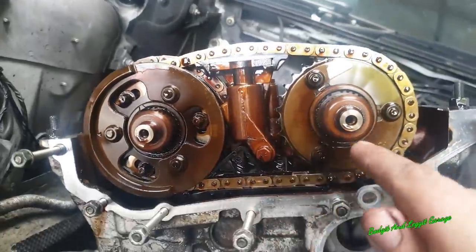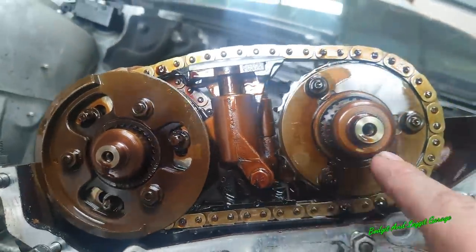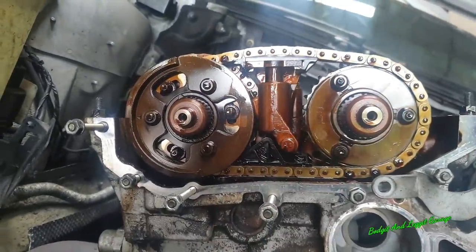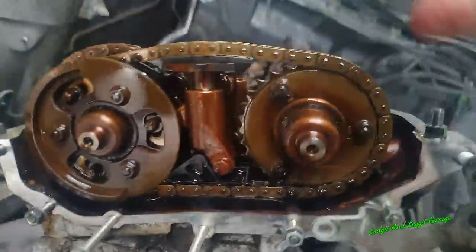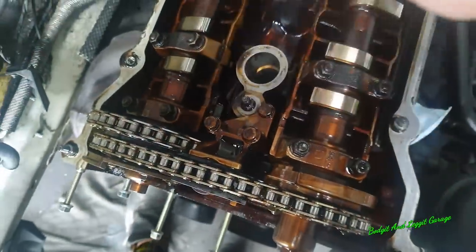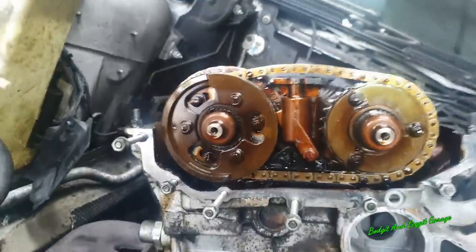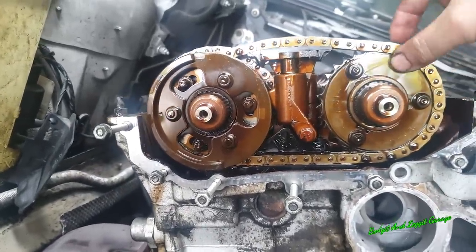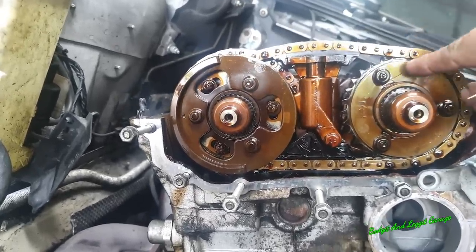Right, now be very careful, because you can see these plates have front on them. You can see the word front. Sometimes it might just have F. So when you put these back, make sure you get them the right way. We need to push this down first. You can see, push that down there, and I'm going to put in behind it, you can see the hole there. I'm going to put this locking pin in, which just keeps the tension off. But when you're reusing this chain, it's timed onto here. So when I remove this pulley, I'm going to put a cable tie in and around here to stop these moving